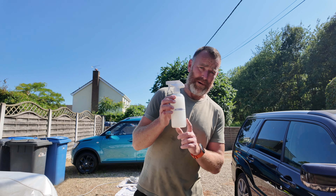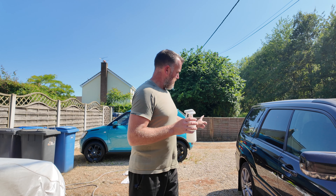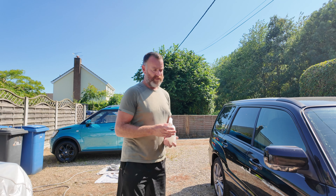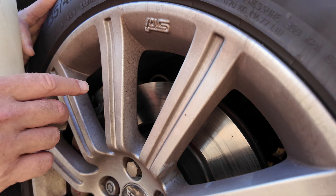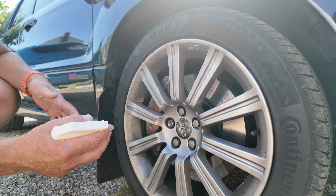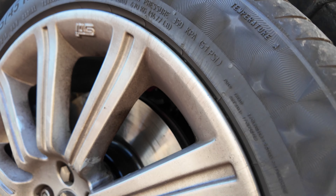We're starting with Bilt Hamber Atom Mac at 5% on the brake discs and also atomising it into the wheel arches. We're doing driver's side front, offside rear, and nearside rear — leaving nearside front naked for comparison. We'll give it a good 10-15 minutes to dry, then rinse off, clean the wheels as normal, and apply again. Getting liberal amounts up into the discs — it's not a magic bullet and won't eradicate rust, but it should inhibit further rust.